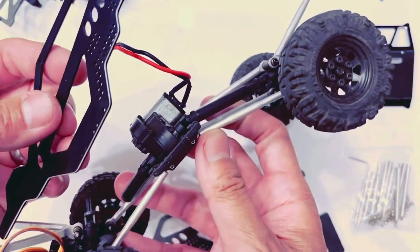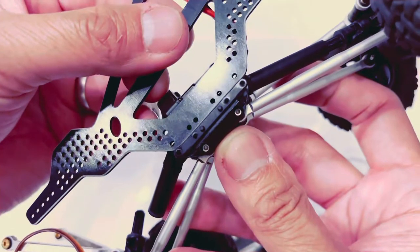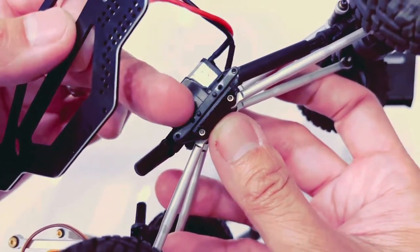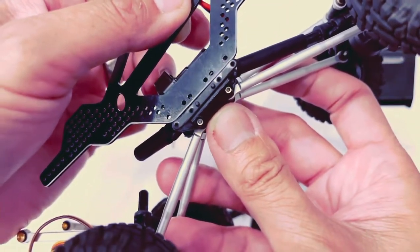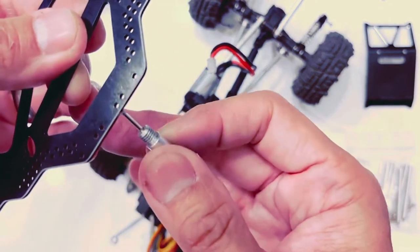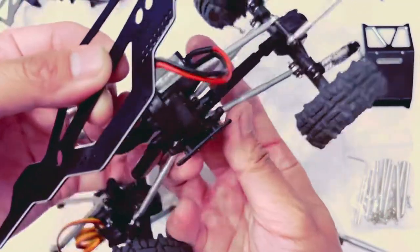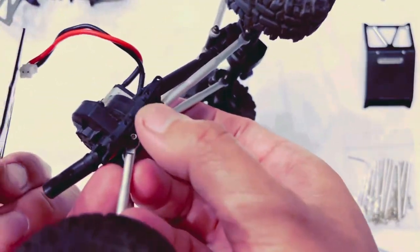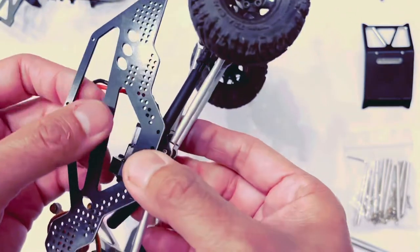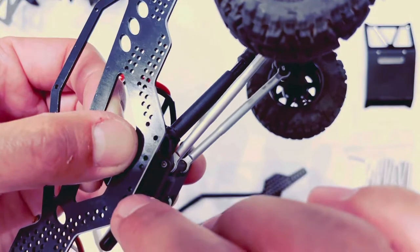We're going to put this together in kind of the reverse way that we took it apart. The last thing we did was remove these four screws, and we're going to put the new ones back in. The holes on the frame align with these: I'm going to use this one, this one, this one, and that one. Those two center holes aren't going to be used. The nubs are going to go in there, and the screws go into the outer two holes — the long ones on the outsides and the short ones on the insides.